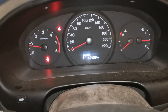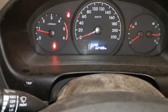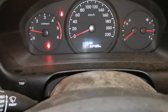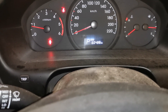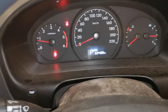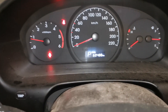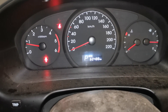That reluctor ring moving away from its position and not moving in a perfectly straight line when rotated was causing the signal to intermittently drop, as seen on the graph earlier. Once the new hub assembly went in complete with a new reluctor ring, it was able to pick up the signal consistently and everything has been rectified. I hope you enjoyed this video and found it useful — if you did, please like, share, comment and subscribe. Thanks for watching.